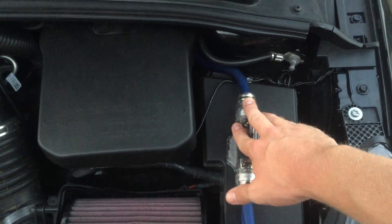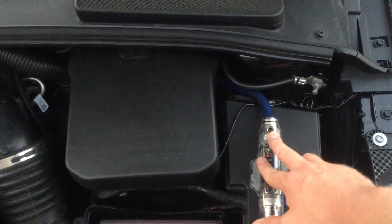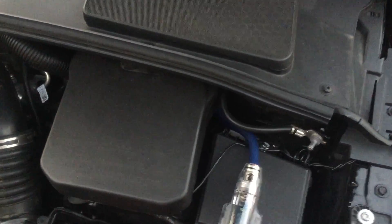As you can see, I've got the power cable already run. It's disconnected from the battery solely because the amp is not hooked up yet — I just haven't had the time to install that, but it's running under the battery here. I'll show you where it's poking through the firewall. Got the LEDs on so you can see it a little easier. It's running right there, coming out, going under all of this, all the way through the back — comes out the trunk right there. And that's where the amplifier and the crossovers are going to be installed.